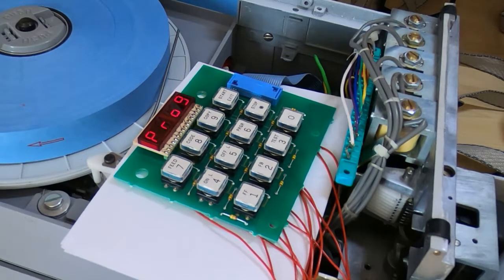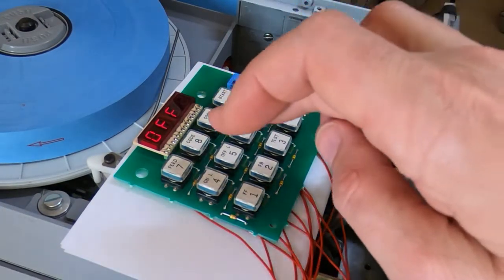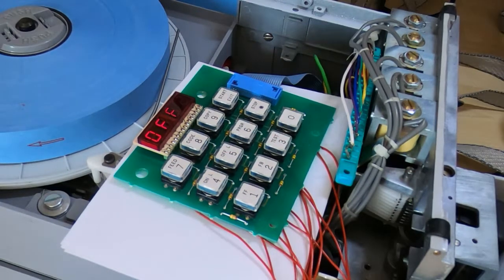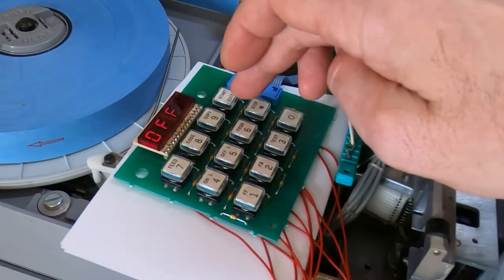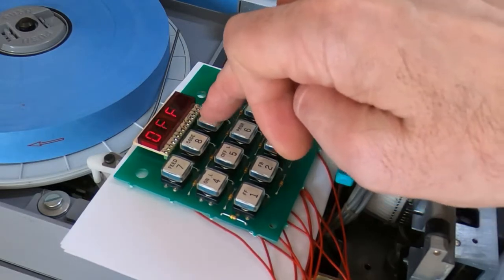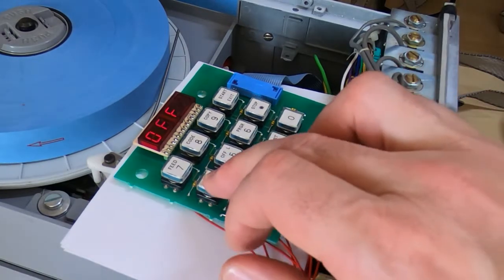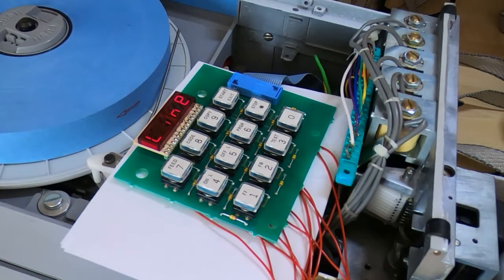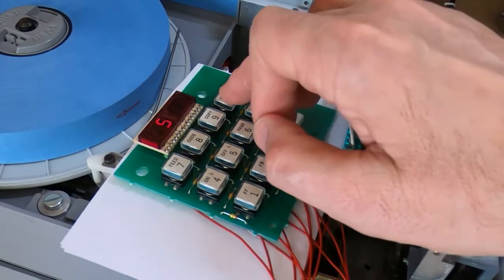I can then set the parameters as to what I want, but unfortunately it will revert back to the online state whenever I try to do anything else from the keyboard. That's fine for most of what I'll be using this for - reproducing tapes or reading tapes. But if I wanted to use this machine to its full capability I need to fully unlock the keyboard. In this state, whenever I try to access any of the high-level functions I get a 'busy' signal which, according to the manual, means there's data in the buffer it hasn't yet printed. There's no way around this other than to go back to line mode, but when I do that the keys don't work again and it's expecting a passcode. As you can see, it's not a complete workaround.